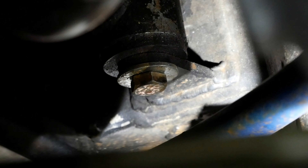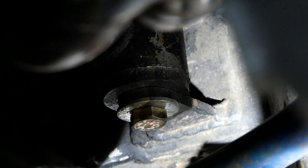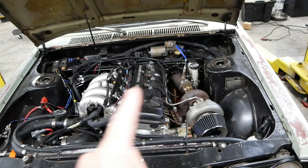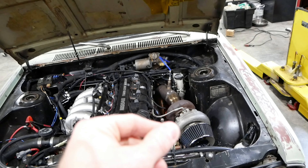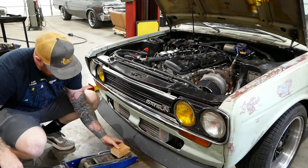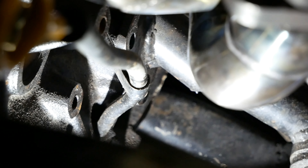Back out here a few days later. I'm going to finally tackle the thing that's driven me nuts the most on this car, and that is the motor mounts. I've got an exhaust on it now so we can actually run the car — it's time to swap out those poly bushings for rubber ones. What I'm talking about is right down in there — that is the motor mount that I made, and those have polyurethane bushings in them. My plan is to remove the motor mounts from the car one at a time — undo it from the block, then undo from the cross member, take that motor mount over to the bench and take it apart. I've just got a block of wood I'm going to put on the oil pan so that we don't dent it up at all.